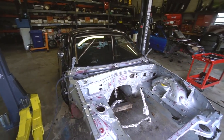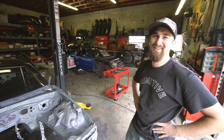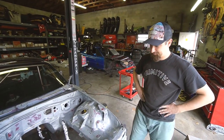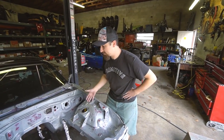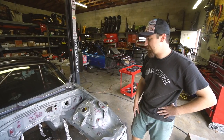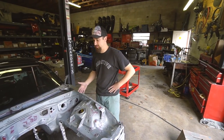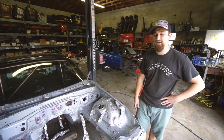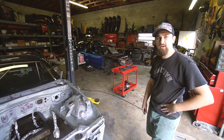Sanded and prepped. It's about two hours later. When it comes to painting, it's going to turn out as much time as you put into it — you can feel as you're going whether it's smooth or rough, and that's how it'll be after. For something like this we're going a little quick. Next step is masking off the windshield and throwing a car cover over the whole car because overspray gets everywhere. Then mix up the primer and go.